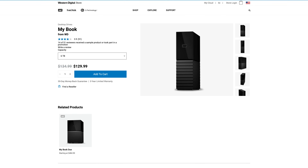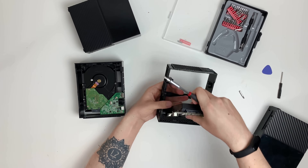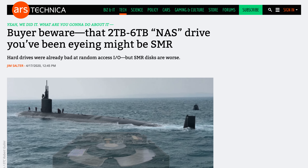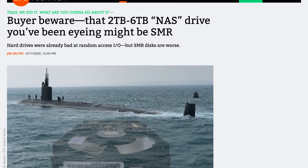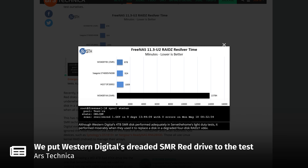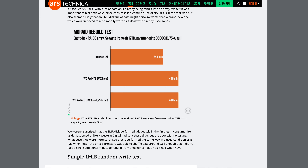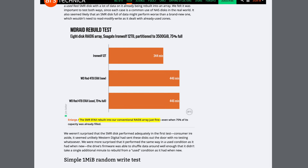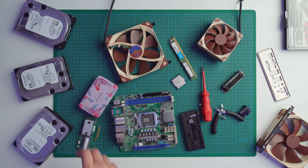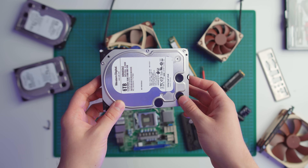Hard drives are probably the most important part of a NAS build, and here you have three options. If you want cheap drives, get these: 6TB WD Elements external drives, which you can take apart and use as normal SATA drives. The problem is they're based on SMR technology, which makes them slower and probably less reliable in the long run. You should definitely stay away from SMR drives if you plan on using ZFS, because re-silver times are incredibly slow. That said, they're pretty good for casual use and go for as little as 90€ on Amazon Warehouse. I've been running these drives for one year, pretty much 24/7, and they haven't failed yet.